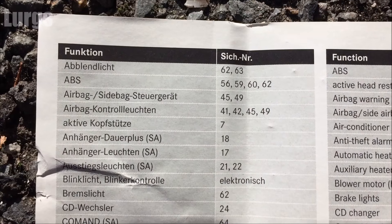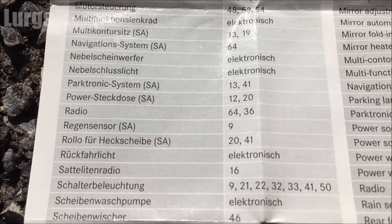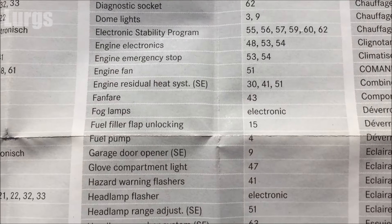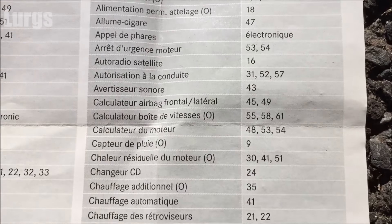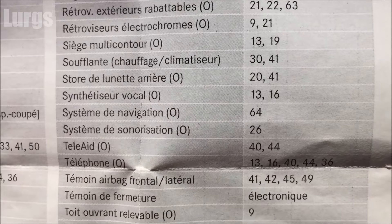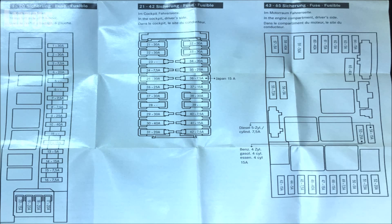So those are the two fuse boxes on the Mercedes C-Class. Now this is the fuse allocation book — I'm going through quickly but you've got the beauty of pausing the video. Not all of these fuses will be on your car; it depends on how many gadgets you've got. If you've got a very flashy C-Class model, there might also be a fuse box at the back in the boot. The front two are a mirror image depending on whether you have left-hand or right-hand drive.